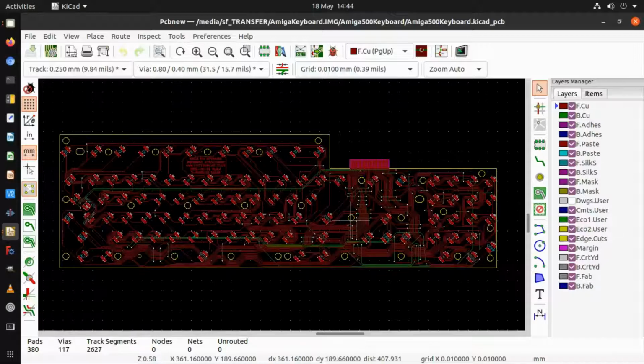And the way I got those into the right place was when I print out a PDF of the circuit, so for producing at home using ferric chloride, whatever, on my actual PC screen, it actually shows exactly 1:1 ratio. So I could overlay the Amiga keyboard matrix on top of the actual screen. I could see how well things were lined up, and that was immensely helpful, because I can go through trial and error and get it as correct as I can.